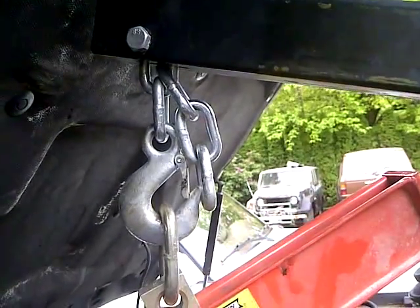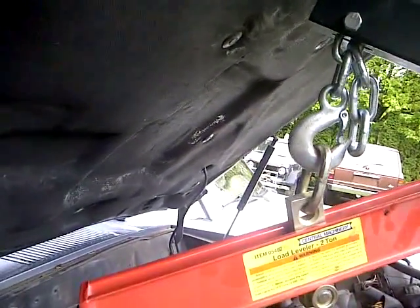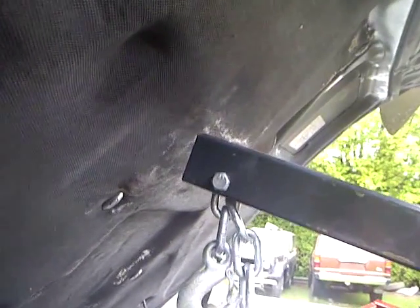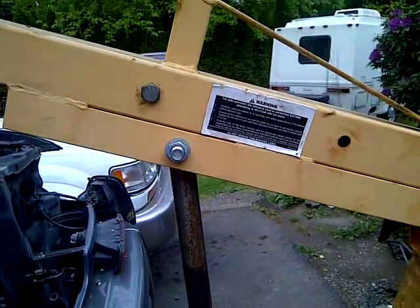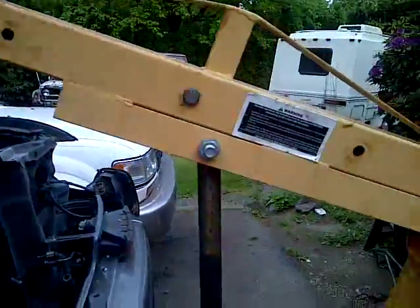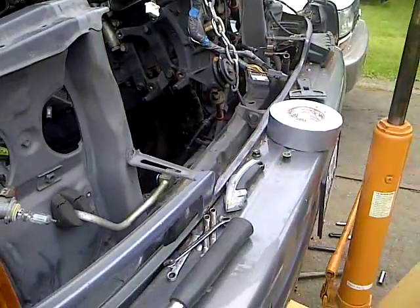It's pretty high. You can see as I'm coming out it hasn't hit the hood yet — the hood doesn't have a lot of play and it's close though. You can see how far I've pulled it out so far. You also want to make sure your engine hoist is as low as possible to get the most leverage and lifting power.